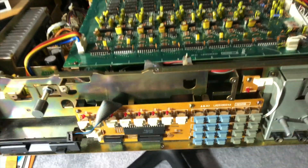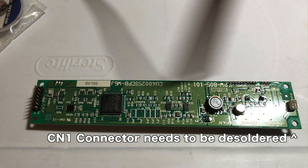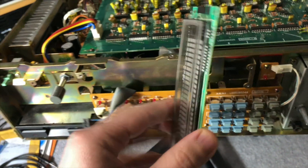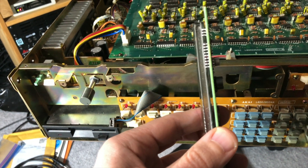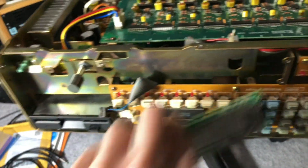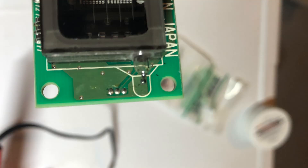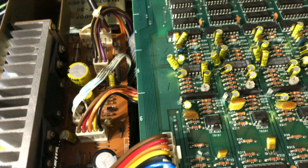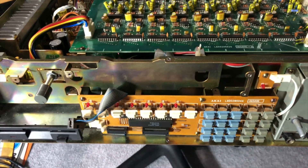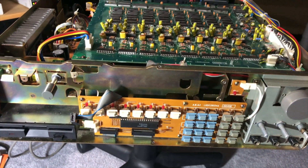The problem is — I'll show some more pictures — there's a connector right here called CN1. When you put this display in normally it would sit in front, but this display is a lot thicker than the regular display, so you have to put it behind those tabs and put the screws in backwards. The problem is you can see this metal on the side here — it reaches this part and shorts the 950 out, the F2 fuse blows, and you're like, what happened to my 950?